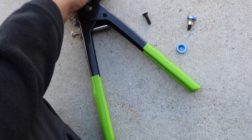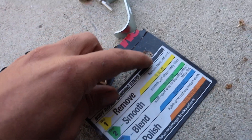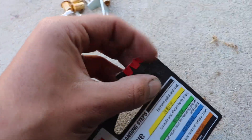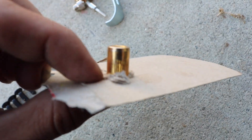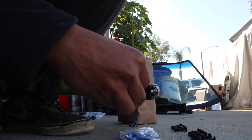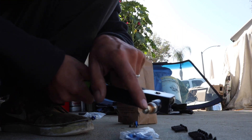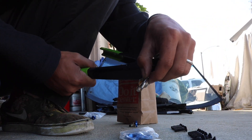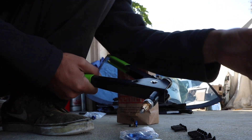I recommend doing some test pieces. I got about 10 extra and I've been messing around to make sure my depth is where I want it. I'm going to waste one to show you guys. I drilled a hole with a 3/8 bit — now I'll slide this in. It should be pretty tight; you don't want it loose so it falls out. There you go — that's what it looks like from the outside. The outside won't change at all. Now we're going to crush it — just thread it on. Make sure the thread pitch here matches your bolts, because it comes with different thread pitches. If you try to use the wrong one, it won't thread in or you'll mess up the threads and your bolts won't work.